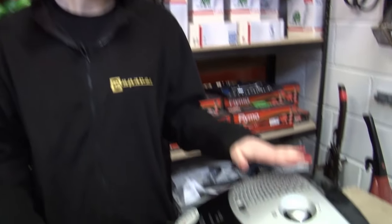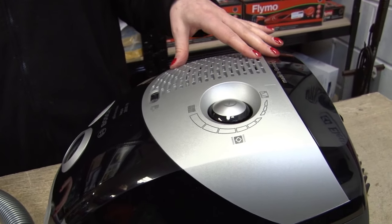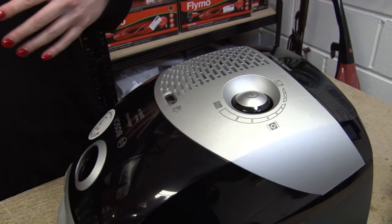Lastly, if you've tried all of the above and you're still experiencing a loss of suction, then it's probably due to the motor. The motors in all Bosch vacuum cleaners are replaceable. It's not the easiest of jobs, but it's certainly doable. And you may find that you don't need to replace the whole motor — just the carbon brushes in the motor.